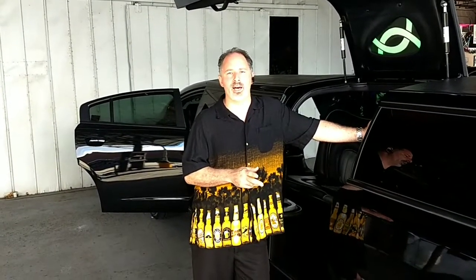To recap: the second AC compressor on these cars is not too big of a deal to replace. If your vehicle was built by Pinnacle, they used one out of a 2013 Chrysler 300 with the V6 3.6 liter — you can get that AC compressor anywhere. I was able to get mine at Advanced Auto Parts, and they come with a lifetime parts warranty. You can find them cheaper on eBay or order from the manufacturer, but buying from Advanced Auto Parts — they're right across the street and they guarantee lifetime part replacement, so that's worth it to me.